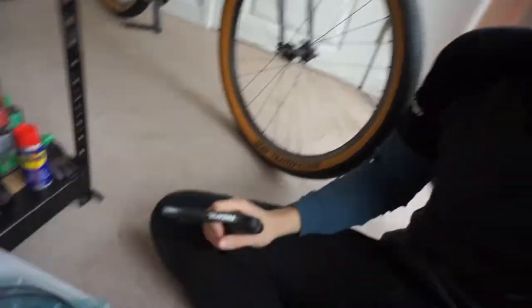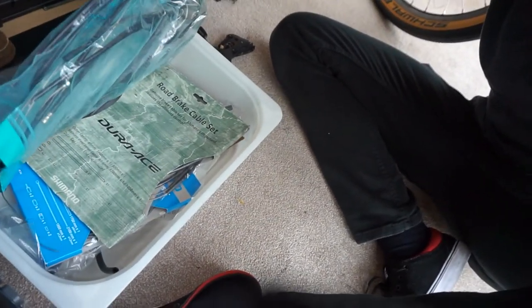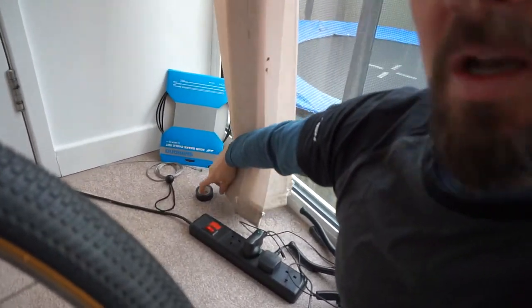On this episode I'll show you all the details of getting the 1x10 wide range drivetrain going, so we actually get the bike shifting through the 10 gears. I need to get this front wheel off and put it back in my Elite work stand. I've got a box here of all the different gear cables, and in this corner I have my brake cable and a bit of electrical tape for running that rear cantilever brake.